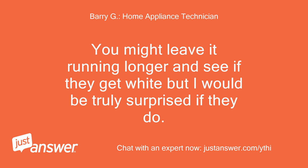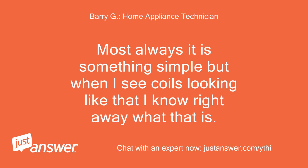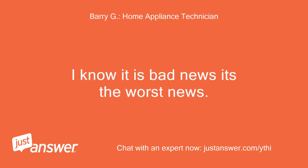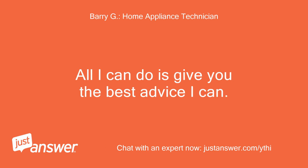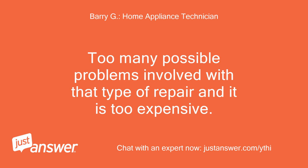You might leave it running longer and see if they get white, but I would be truly surprised if they do. It is an expensive repair. Most always it is something simple, but when I see coils looking like that, I know right away what that is. I know it is bad news, it's the worst news. All I can do is give you the best advice I can. I really think you would come out better getting a new freezer. Too many possible problems involved with that type of repair, and it is too expensive.